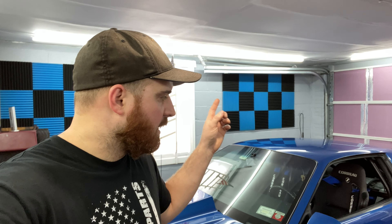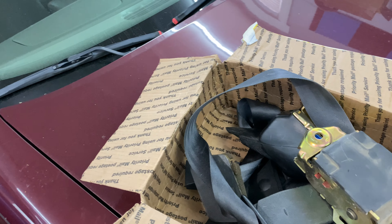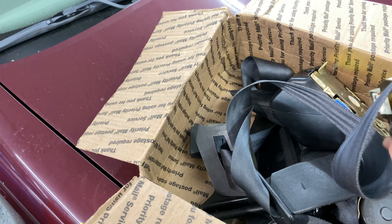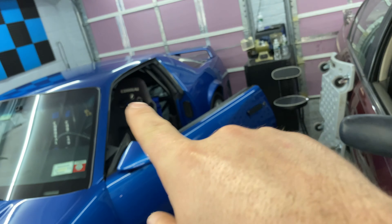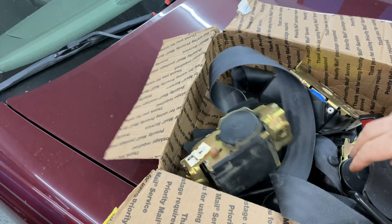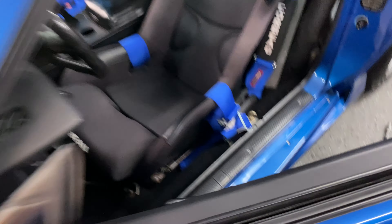But instead I'm going to do something that honestly I can't wait for — I'm so excited to get it done — and that's putting the stock seat belts back in. I got this off eBay for cheap, like under $100 for a full set front and rear. I don't need the back so I'm probably going to end up selling them. They're this graphite blackish-gray color, they should match pretty well, and they mount in the exact same spot as the third gen belts — right in the little recessed pocket on the roof, then they come down to where the retractor on the stock belts went.